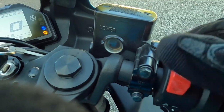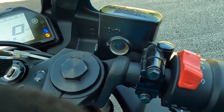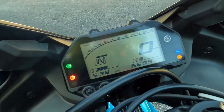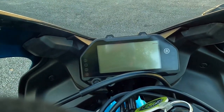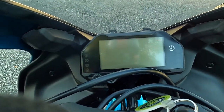On the right side, the kill switch — for the R3 it's two-stage. When it's up all the way the bike is off and the battery is off. But as you can see, the bike is totally not off until I turn the key. Now the bike is off. All right, now I'm going to show you how to start the bike when the bike is not in neutral.